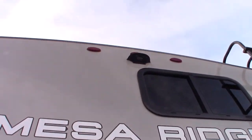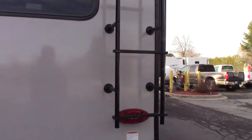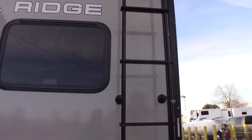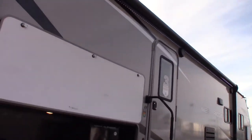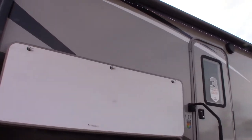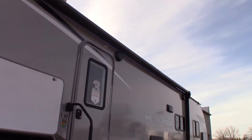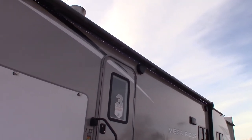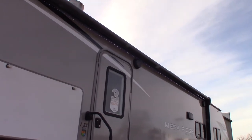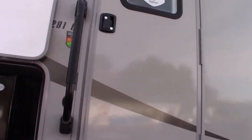There's your backup camera mount — it's pre-wired and it's an option. You have a ladder here, which is great because the manufacturer states you should inspect your roof every 90 days. Someone needs to go up there every 90 days and check the seal on the roof, make sure there's no cracking or separation, no damage to any of the attachments or the roofing material from low branches or road debris. Make sure you keep after that — it's an important thing to do.